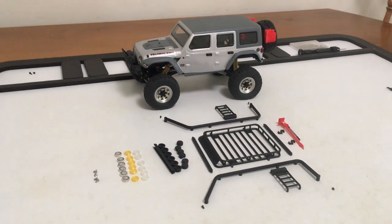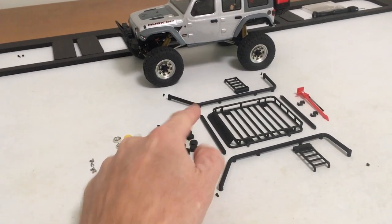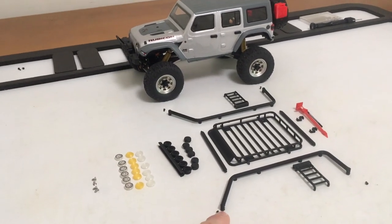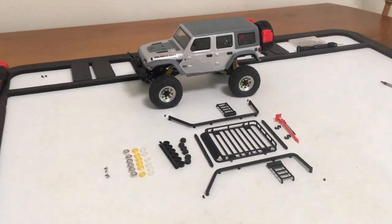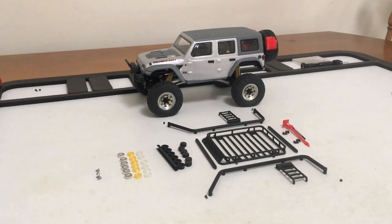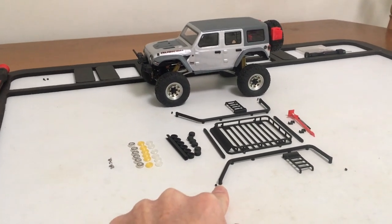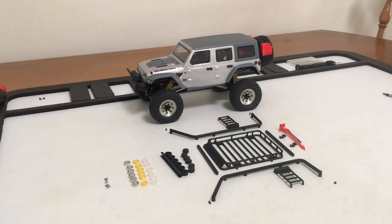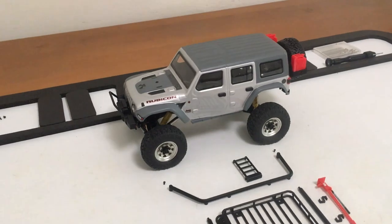So anyways, I took the original one and heated up the joints at the top and kind of bent it outward a little, and dremeled off a little of the mount, and was able to fit that one to another body. So I test fitted that one, drilled it, got it fitted, and then I actually dry fit this one onto that other body. Of course, didn't glue it with the longer mounts. And now I feel pretty comfortable, I think, to actually mount it and poke some holes in this body and get it mounted in there.